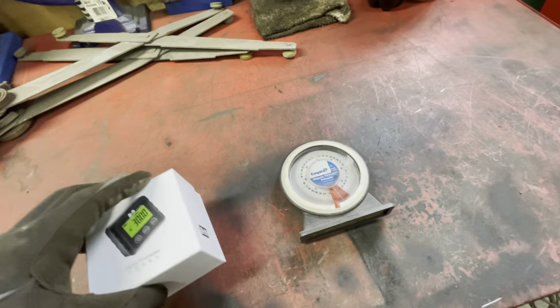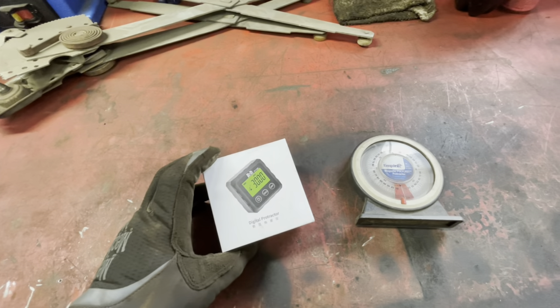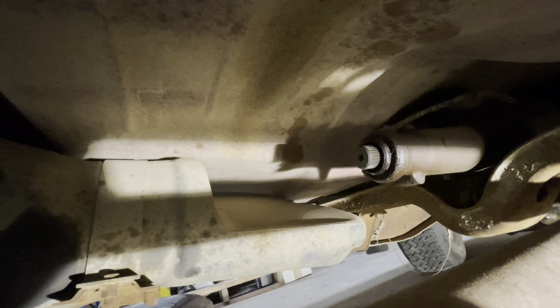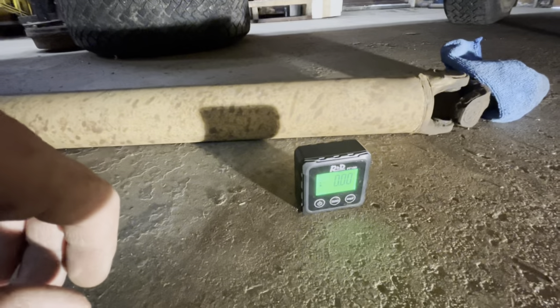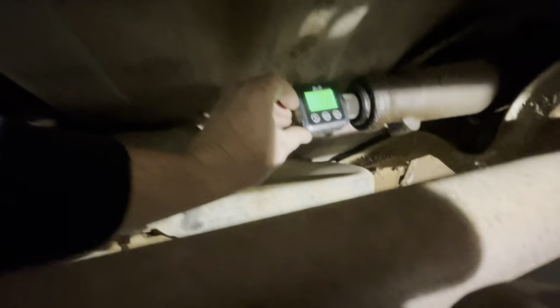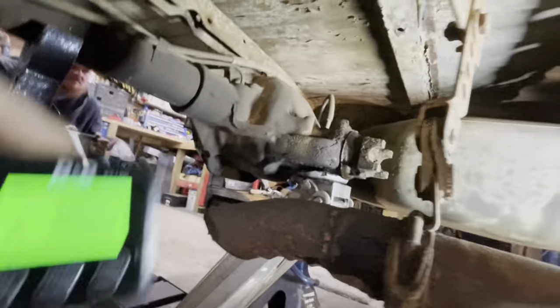To set the pinion angle you're going to need a way to get the angle - a protractor. You can use one of these cheap ones, about 15-20 bucks, but I finally bought a digital one for 30 bucks on Amazon - 10 bucks more and you get a nice digital one that's a lot smaller and easier to use. So the output shaft of the transmission - I'm going to zero it on something flat, so it's sitting at zero. Then we take it to the pinion angle on the output shaft and it's sitting at 1.3 degrees down - it's coming off the truck going toward the ground at 1.3 degrees.